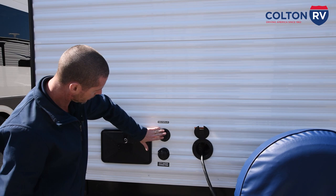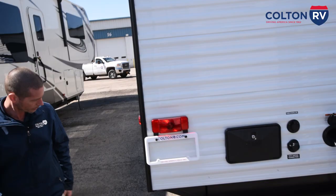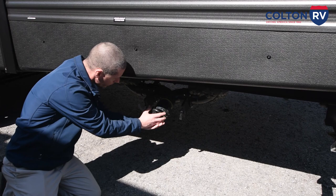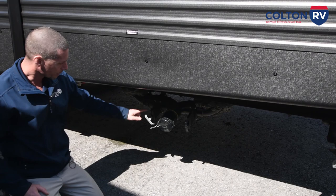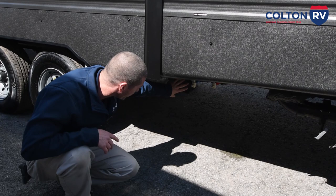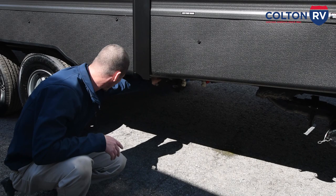Right here you have an outside shower. And then right down here is your dump station, your sewer connection. All you're going to do is take the cap off and hook up your sewer hose. Now on here the big valve with the black handle — that's your toilet water. The gray handle here is your sinks and shower. Right here you have low point drains for your hot and cold water lines. And then you also have another sewer connection here for your other gray tank. You have two gray tanks — one does your kitchen, one does your bathroom.